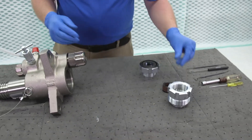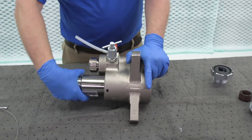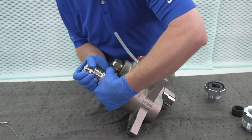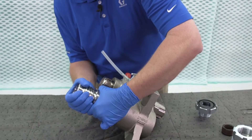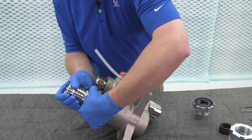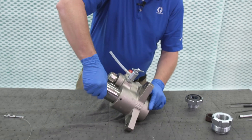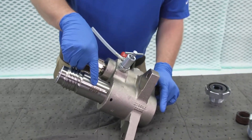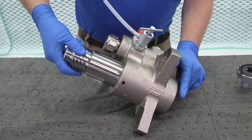Now we're going to come back and take off the cylinder. We use this pin to help keep the cylinder in place. One thing to note: when you undo these it's fairly difficult at first because we have a fairly large O-ring on the top of the cylinder. Unfortunately, this thread is quite fine so it does take quite a bit of turning before it comes loose. As the cylinder spins around, you'll notice we do laser-etch the size of the pump in the cylinder so you know what size you have. In this particular case it's a 180 cc lower.